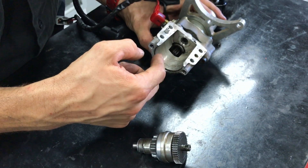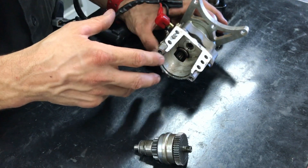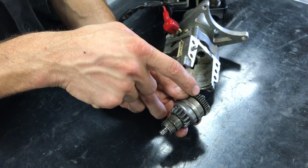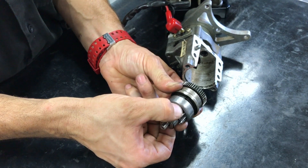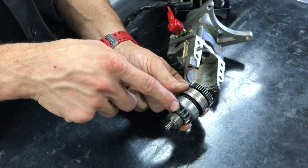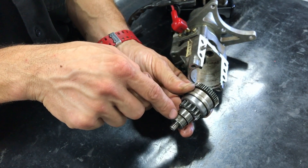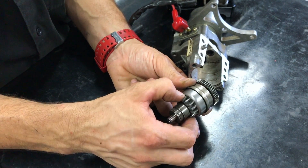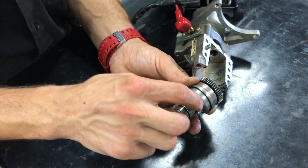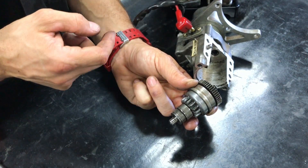This one's pretty clean, but these normally get really gummed up with chain lube that flies off, plus bits of rock and dirt. This is the starter reduction gear — when the starter motor turns, the Bendix or starter reduction gear spins and comes out, engaging the ring gear to turn the engine over. When there's too much dirt and chain lube, there's too much resistance for the starter motor, so you'll press the button and it will spin but won't throw all the way out, which can also cause wear on the back of your ring gear.